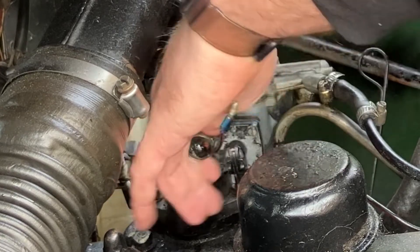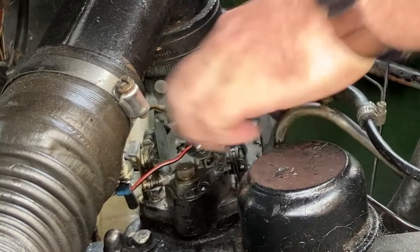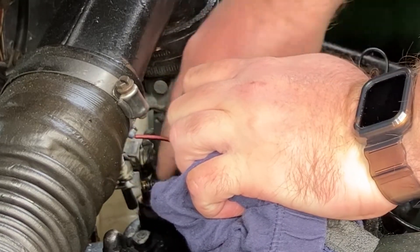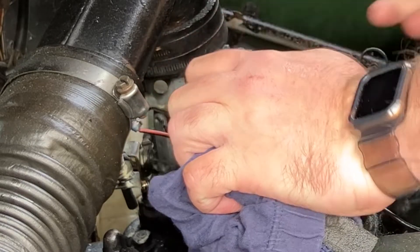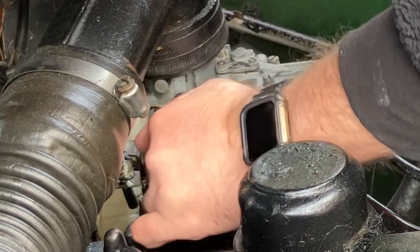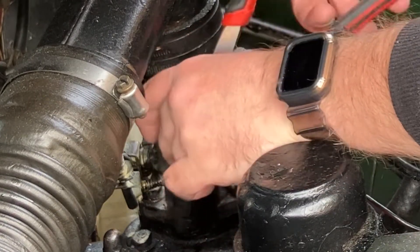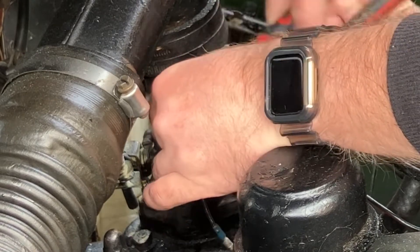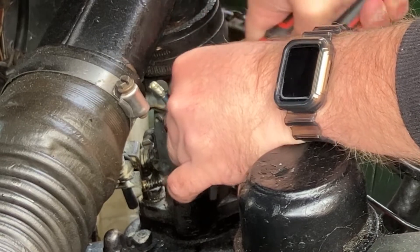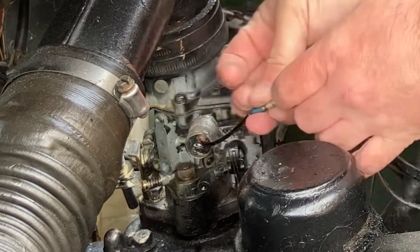Making sure there's metal-on-metal contact. That's why there's only one cable — it's using the earth through the metal, touching the outer metal casing of the solenoid. The positive, or the live wire, which is actually a negative on this car — it's the opposite to your normal. So your positive and negative are connected through the body of the car, through the engine, and through this other wire, making the circuit. It feels fairly tight, so I'll give it a tiny tightening with the wrench, putting a bit of foam around it so I don't crush the piece.